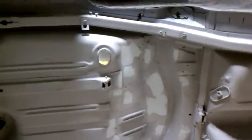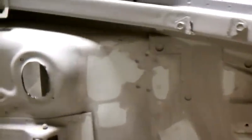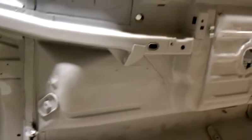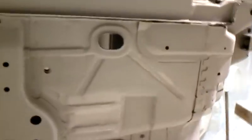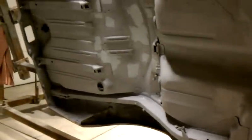I've gone down here and spot puttied some of the marks that aren't going to look so nice. If I painted it as-is, these are — I don't know if you'd call it pitting from over the years. I've got it all spot puttied and you're going to spray primer over it. All the little repairs from going over the lifts and the nicks — I've taken care of some of the dents. I've done actual body work down here, putting body filler on some of the shallow dents and little dings to make it look that much nicer when it's all painted satin flat black.